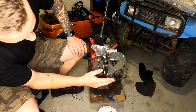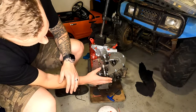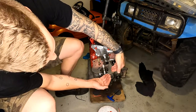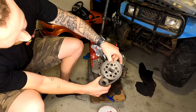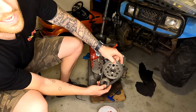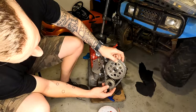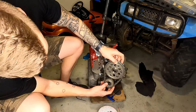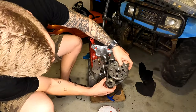Here's Tomo's Tech Tip. Before you start the reassembly process or even installing the timing chain for the first time, get the old gears for the crank and the camshaft and line them up so they are facing each other dot to dot. This will ensure that the cam and crankshaft are at the base setting for the engine when it needs to be timed. That way when you get your new chain you're not going to be sitting there messing about trying to line everything up, and it also ensures the new chain goes on the correct way. The problem we had originally was that it was out by probably one tooth. As much as we adjusted it one way we started moving in the right direction but tapped out with the amount of advance, and it didn't actually go on correctly — it took us a while to work that out.